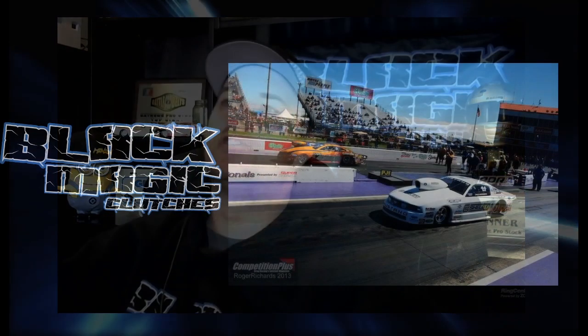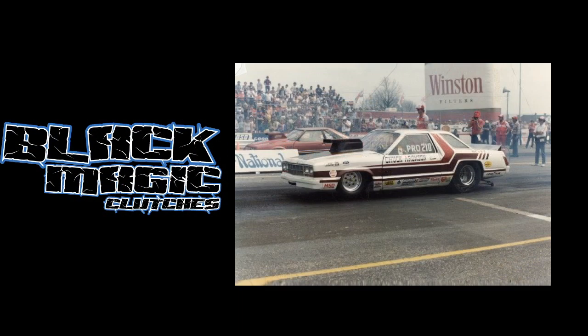So to answer the question of slippage in the gear changes, off the top of my head, you would probably be trying to target somewhere in the neighborhood of about 5 to 7%, which would be about optimal for your car. The thing that makes it tough to hit is the size tire that you would potentially run. What I always look at is your drive shaft RPM. And when looking at your drive shaft RPM, notice the engine or tire spike that you get, you're really just trying to minimize that.